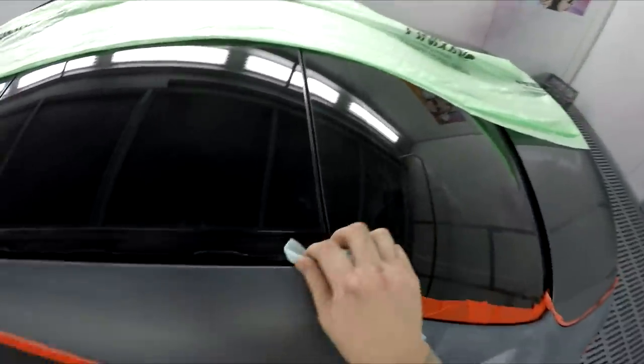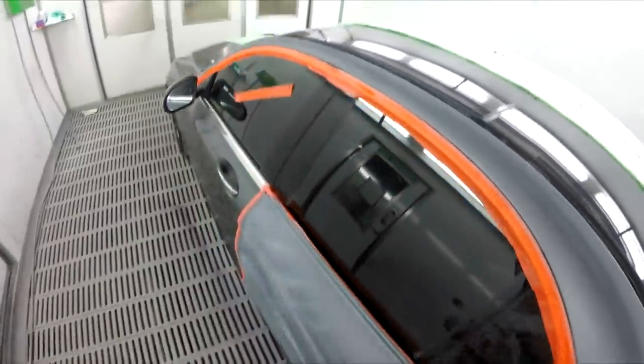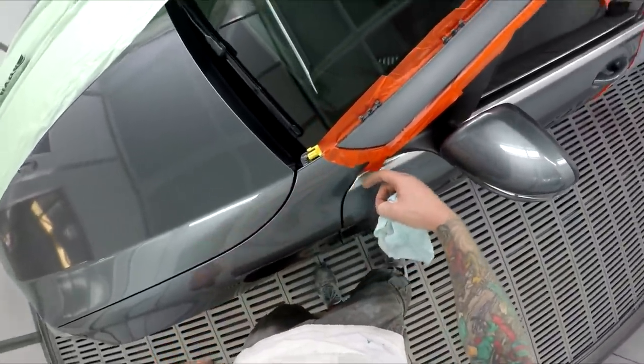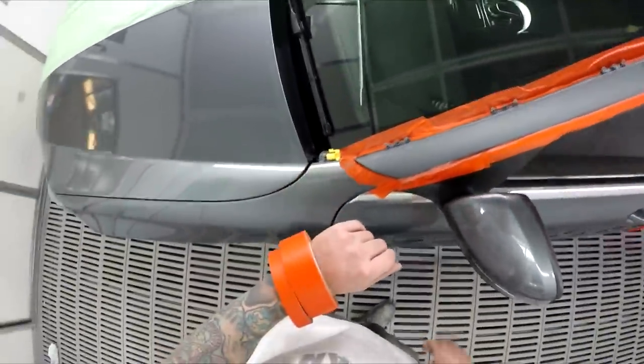You do have to be really careful especially on all these edges. This is where you can possibly get overspray, so I was careful to plug it all up down there. Also in these kind of edges you can get like a little pocket in there where the overspray comes down and gets a misty haze of clear coat all over your panels.